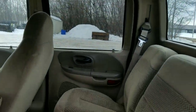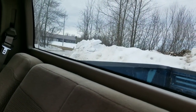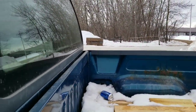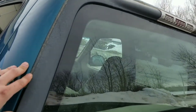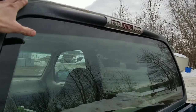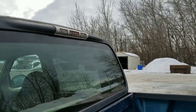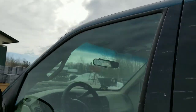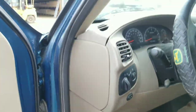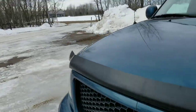Nothing too fancy in the back seat. It did come with a rear tinted window when I first got it, but one of my co-workers busted it out, so there's a clear one in the back now. One thing I've been finding out is that these pickups are notorious for leaking out of the rear windshield. After so long, there's a butyl tape that holds the rear windshield in, and it dries up, gets crusty, and starts to leak — and when I say leak, I mean it leaks like a sprinkler.